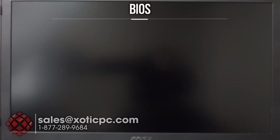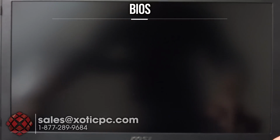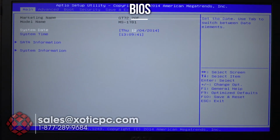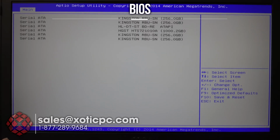All right, we're going to jump into the BIOS to take a look to see what's available to us. The computer is completely turned off. I'm going to hit the power button and then continually press delete. So power and then just spam delete. All right, so we're into the BIOS now. On the main page, we got our system date and time, our SATA information, showing the drives that are installed into it. And there's those 4 256 gigabyte M.2s and then the 1 terabyte drive.